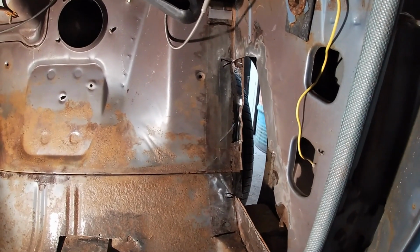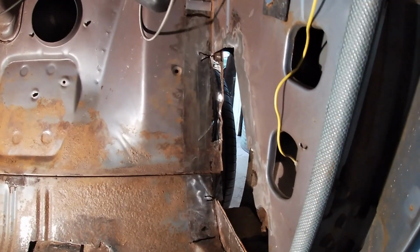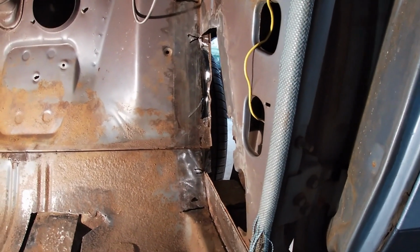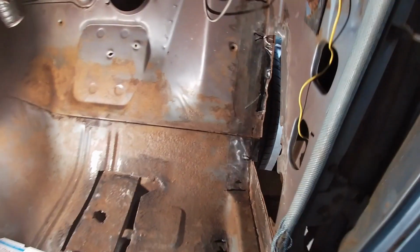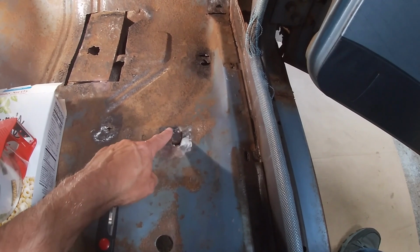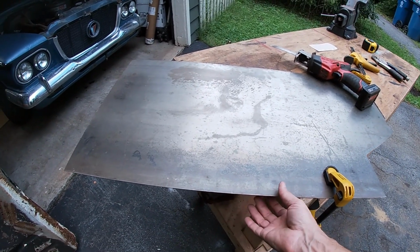This is how I make a template. Take some tape. In this case, I have packing tape. Typically, I use like painter's tape or something else, but it's tape. That's what I had. Then I just tape it on, make some marks, and I'll either tape it on a cardboard or tape it right on a piece of metal and cut it out. I'll do the same for these. You know, the clear tape's nice, I just realized, for this, because you can see it and then just trace it. But, you know, just painter's tape, you just rub your finger and it'll give you the pattern and you just cut it out.